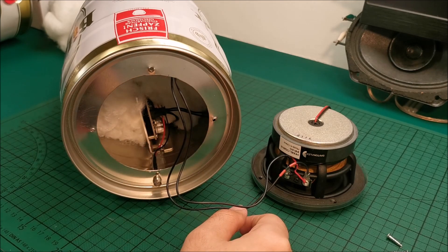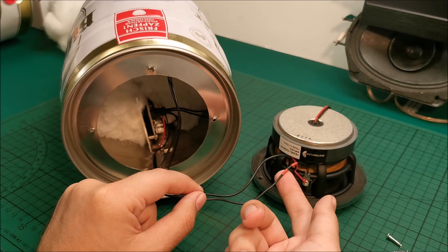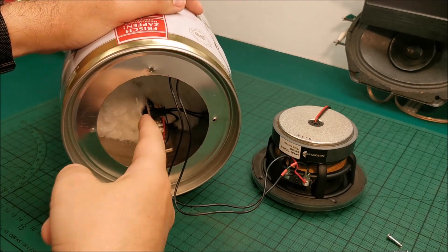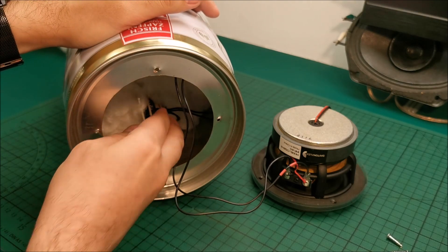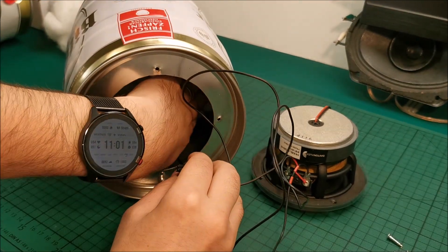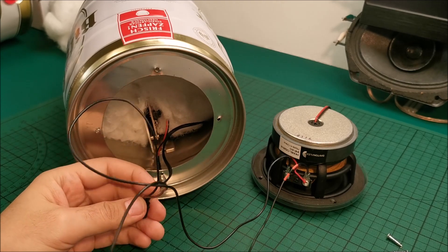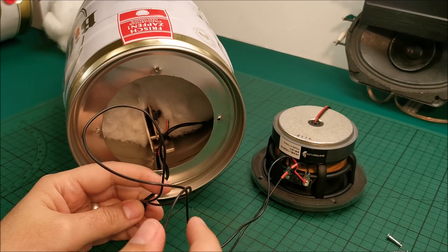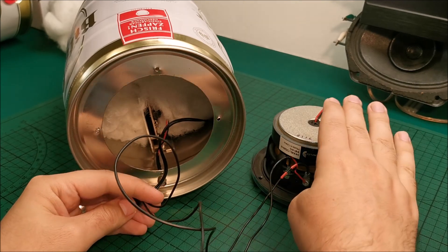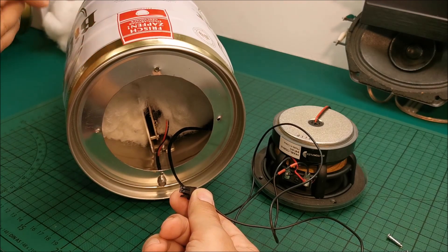The second speaker is opened up. The kit itself — which is linked in the description — came with black wires, so I basically marked my own positive on it before soldering, just for future reference. Now two wires come into this and two wires go to the back output connection going to the second speaker. I need to unplug this — luckily it's quite at hand in here — and I will take a look at the original wiring diagram on my phone, since I don't have the printed paper anymore, to see if what I connected here is correct.